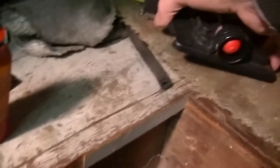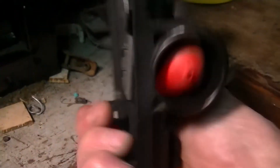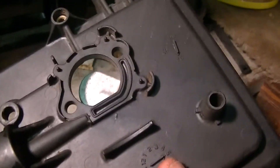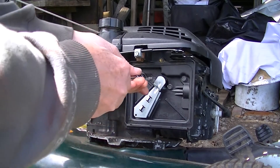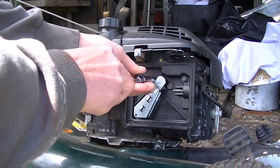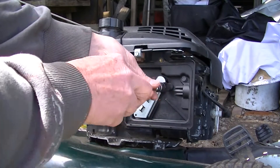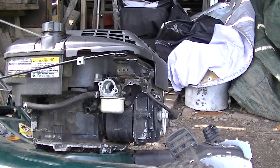I've been really half-assing this repair, I must say. If this doesn't work, I've got to clean the damn carburetor. Everything looks good. Here we go again. I just tried the primer and nothing came out. I hate to say it, I think this carb should come off. I sprayed in there and it's all kind of backing up — it wasn't really going through. So unfortunately I'm going to take it off.